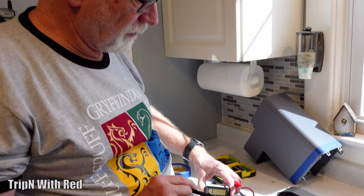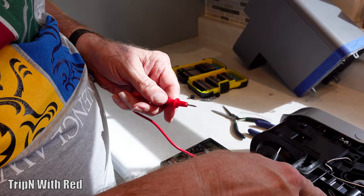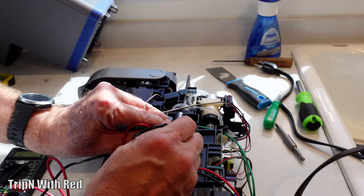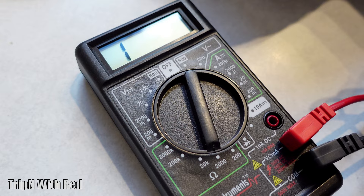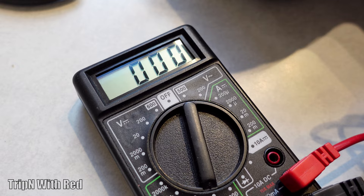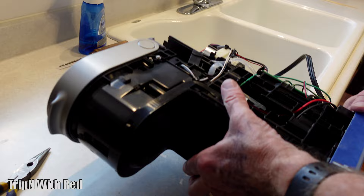We're going to take our voltmeter and check the result. Before the reset, it showed an open circuit — indicated by a '1'. If you touch the leads together it should show about zero. If I've successfully reset that switch it should show about zero, meaning zero resistance. The good news is it's reset — the meter shows zeros, which means the overload switch is reset. By the way, don't touch anything electrical because you might get shocked.